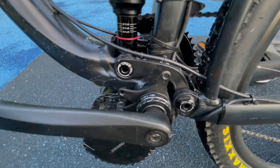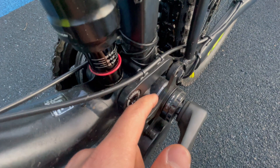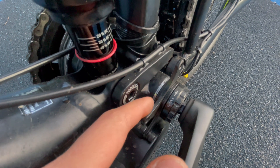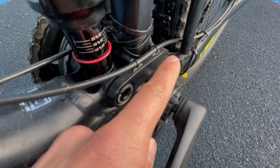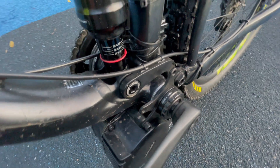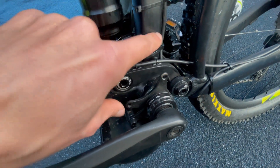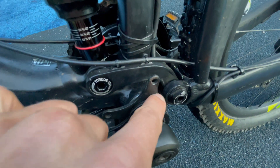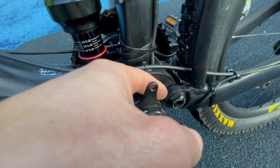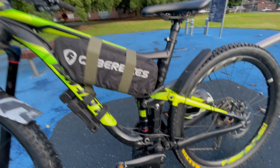This is the bracket system: the silver one is the adapter, the first black circle is the first bracket, then comes the second bracket and the third bracket. We left these two holes so we can attach a torque arm if required, and we ground the ears of the bracket so the suspension can travel freely in this gap here.